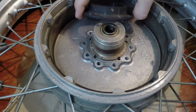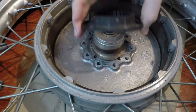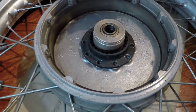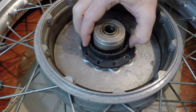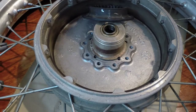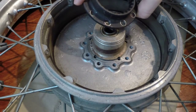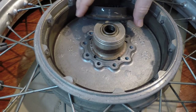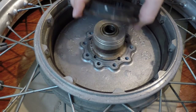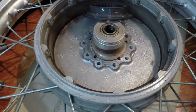The reason I recommend purchasing the slash 6 or slash 7 driving dog is the size of the bolt holes. This is a slash 5 driving dog, and when I was doing this I was following instructions online. I completely missed the part where the bolt holes are different between the slash 5 and the slash 6 and 7. The slash 5 uses a 5mm bolt hole; the slash 6 and 7 use a 6mm or quarter-inch bolt hole. I had already purchased the close-tolerance aircraft bolts to bolt this on with, and of course they didn't fit.